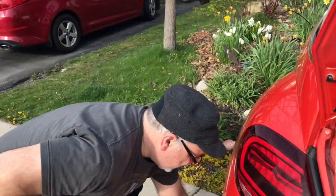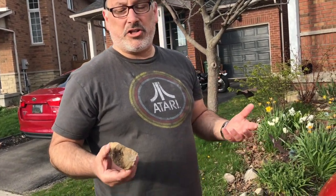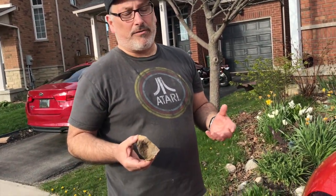You know how in the shop, if we were going to lift up a vehicle, we would do two really important things. The first of which is to block the tires. And if you're stranded by the side of the road, you might not have a set of wheel chocks, but I would suggest that a nice size rock or anything you can find, really, that you can use to immobilize the car while you jack it up will make things a lot safer for you.